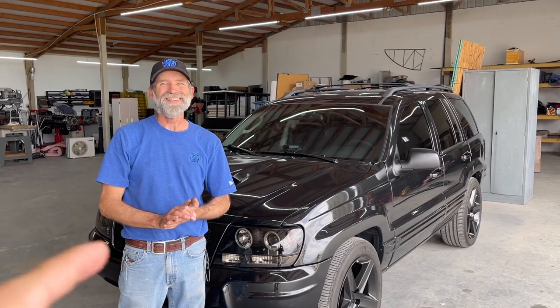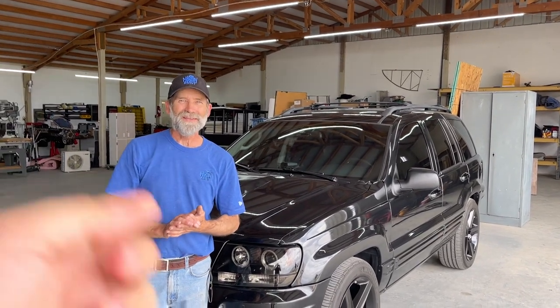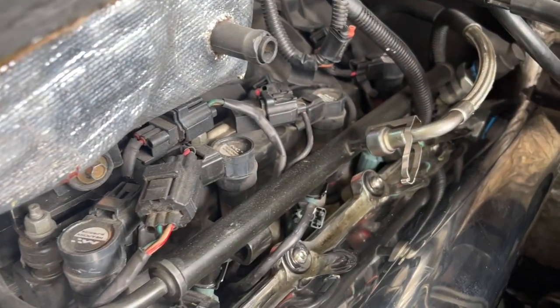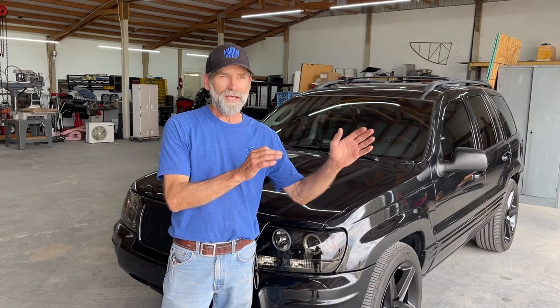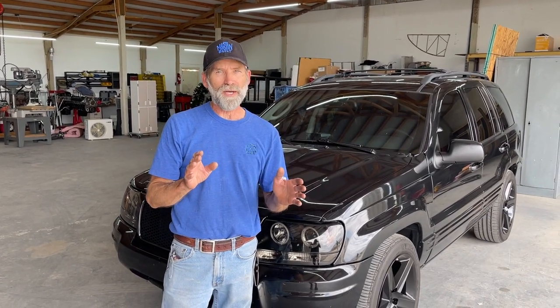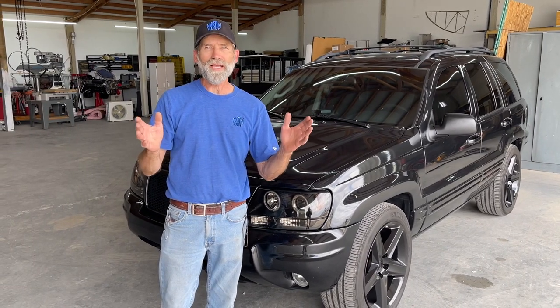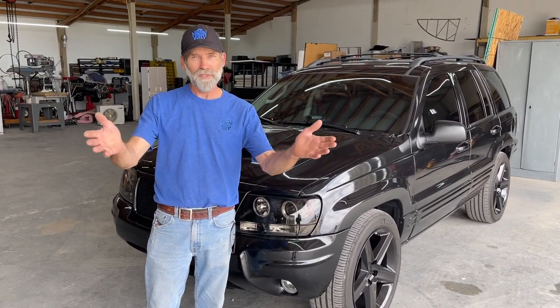And the reason you needed that is because, I mean, you have a cam in there. Do you have the injector upgrade? Another thing too, my theory was that the newer 4.7, the '08 and newer, has a 74 millimeter throttle body on it already from the factory. Oh, okay. So I'm like, why shouldn't I have at least a 74, if not a 75?